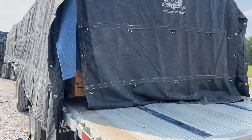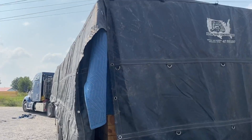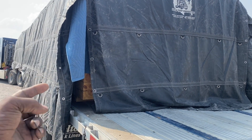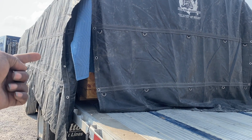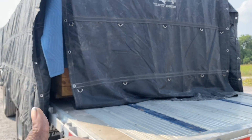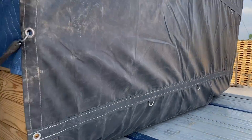We're at the rear of the trailer. What we're going to do is close this flap — the flap has got to go against the load, and then the ends wrap around the flap. The reason is that wind rolls down the side of the trailer — if the flap is open with the tail on the inside, it would catch the wind. So we're going to close that flap. He's closing that side right now.